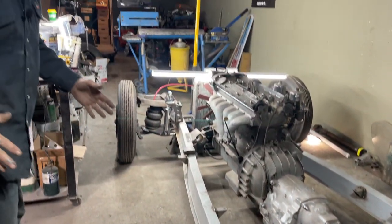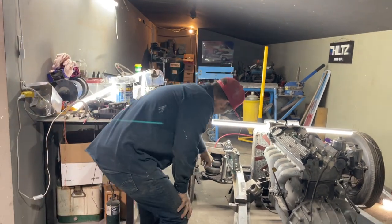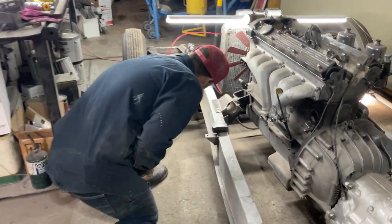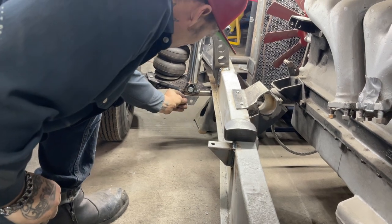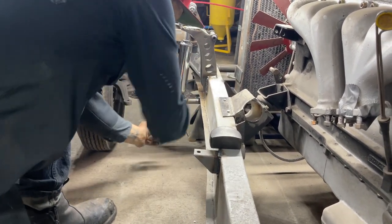First thing I did is I walked in the morning and I looked down. I had a piece, this piece here, I had it welded down here. And when I came in first thing this morning, I noticed that I would not be able to get my rack and pinion arm onto my steering arm, because I left that down in there and had my shock, the shock comes out to here, my shock would be out here, so that would be an interference.